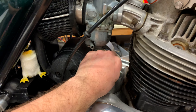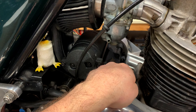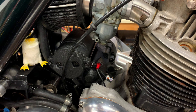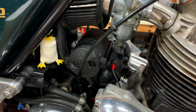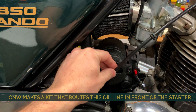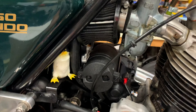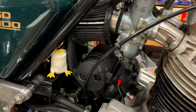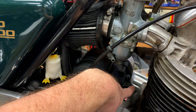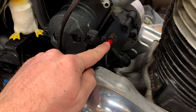That wire is important because normally when you have it hooked up to the battery it's got 12 volts on it all the time. Don't hook it up to the battery while you're doing this, because you've got 12 volts floating around and you're going to arc something. Word of caution there. I'm also not loving where this is routed, so I'll have to tweak that when all is said and done. I'm going to go ahead and hook this end — which is not live — up to the starter now.